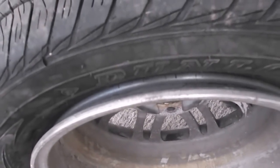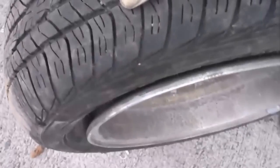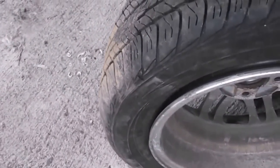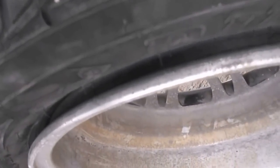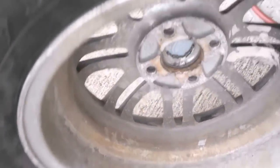It's taking air, it's not leaking, but that bead is gonna really pop so you want to back up a little bit. Another tip: never have your fingers between the rubber and the rim when you're adding air. If the bead snapped against the rim, it would really be unfortunate for your hands. Sometimes you really have to put 60–70 pounds in before it does that and pops in place.